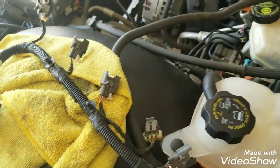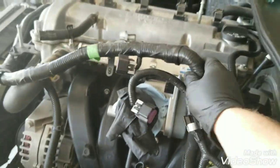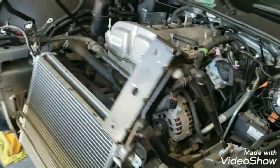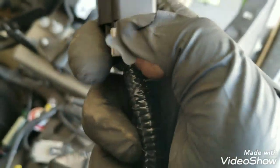What I did next was take off a couple of harnesses — a lot, actually. This one was for the fuel rail, which unclips easily from underneath. There are four. Before I started unplugging everything, there's absolutely so many. At least I have pictures of everything, how it looks, in case I forget something. There are your coils — everything's on clips, pretty easy stuff. Make sure you don't break the clips, though. The way they come out is these pop down, then you just press on them and pull out.